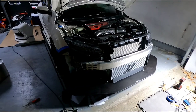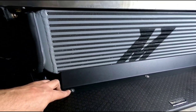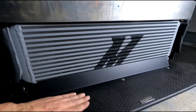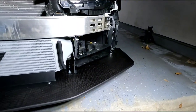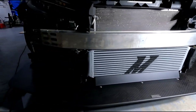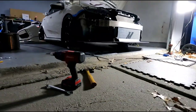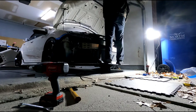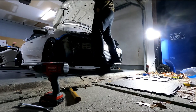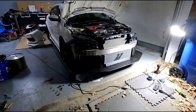Alright guys, I finally got it on. I installed the side mounts to the anchors. Putting the diverter in is pretty easy — just little screws. You measure it out and try to reflect the air back into the intercooler. Line it up and it's the same thing on both sides. Pretty strong — did a little test there. Pretty sturdy. So now I'll get the bumper back on and get it back up and running. Thanks for watching!